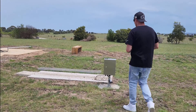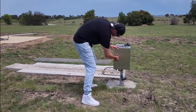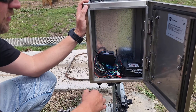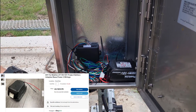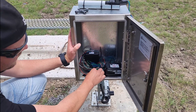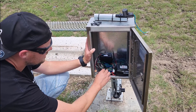I'm going to show you what's inside this box but don't be alarmed - it's quite basic. What we've got in here is the controller. Now these things I worked out run off 12 or 24 volts. What I've done is wired it to a Makita battery - or you can use a Milwaukee or whatever adapter you can get off eBay as well. All we've got is the green and blue wire out here. There are instructions that come with them showing which wires go to certain doors, but I'll run through that later. And then you've got the power supply here which goes straight onto the Makita adapter.